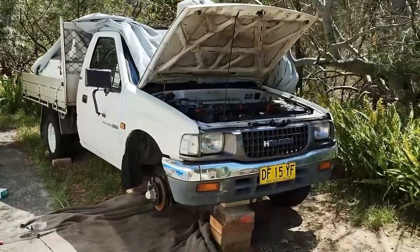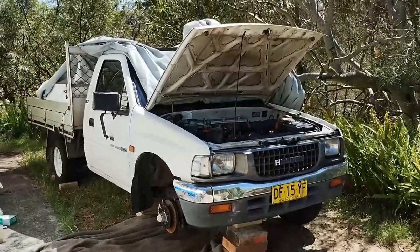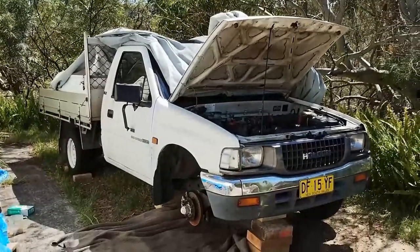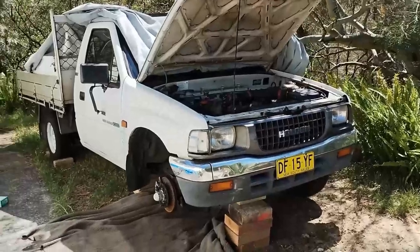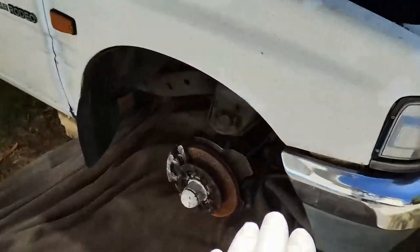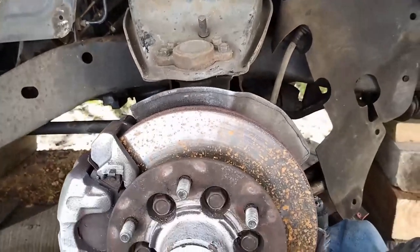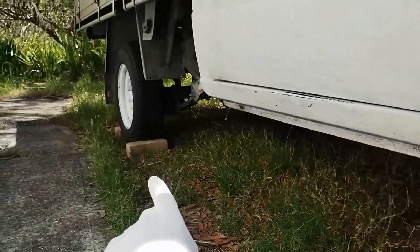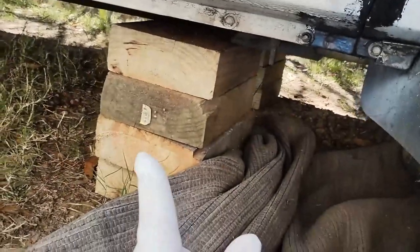Date stamp: 19th of November 2023. This is a starter motor job on a 2.6 Holden Rodeo from 1995. When you first look at it, it's a bit daunting, however it's fairly easy if you remove the number one wheel and also the skirt, so then you've got this cavity here. The rear wheels on the front and back are chocked with bricks and the car is up on blocks.